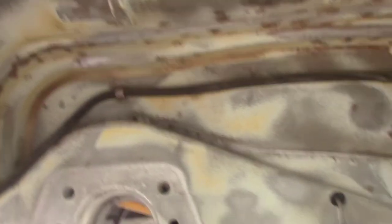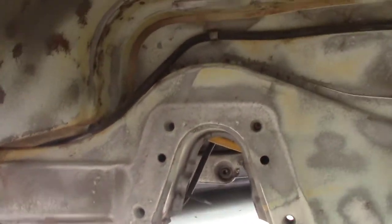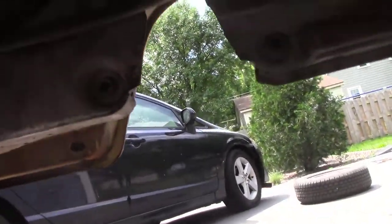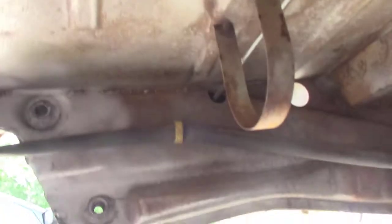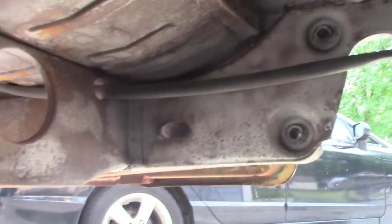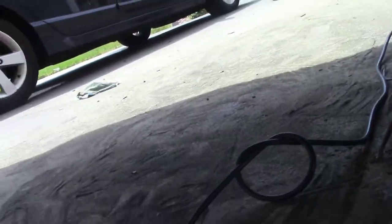While the beam was out, I took the opportunity to spot-blast all the areas that the beam covered. You can see I'm inside a fender well here, also doing some sanding — the same type of prep you've seen me do before. Even the inside where the bolts go through has been spot-blasted and sanded. The upper deck above the beam is all sanded and treated, basically trying to get everything POR-15'd that would be difficult with the beam installed.